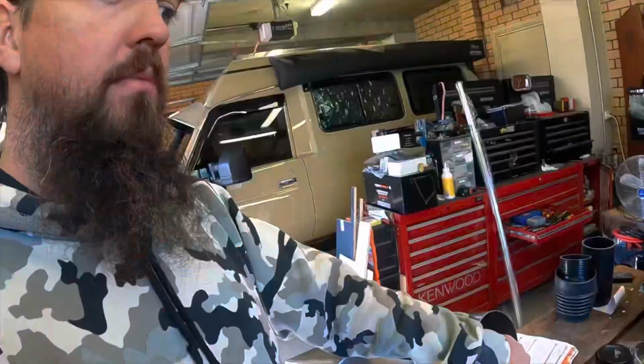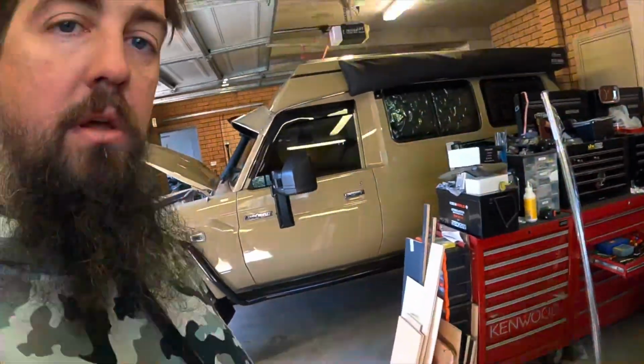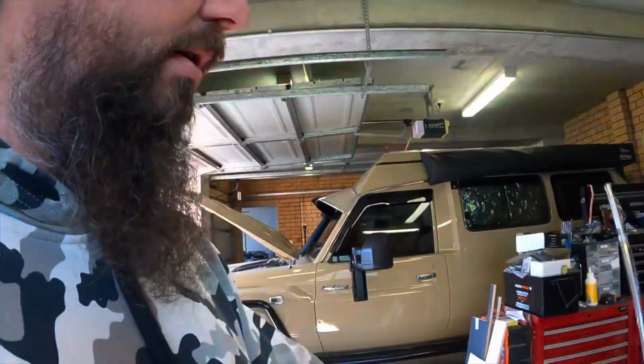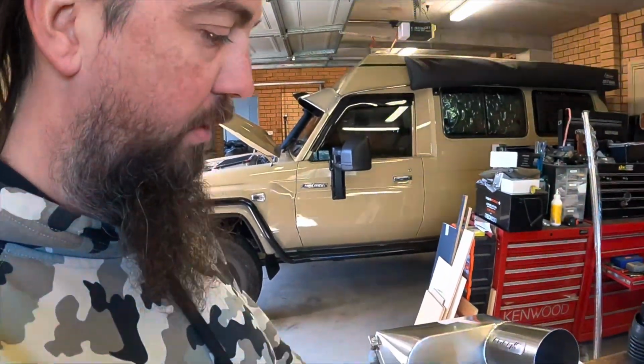The other thing was, there was a little bit of excess material inside that filter housing from the fabrication process when I received it, and there was nothing in the instructions about making sure components are clean, because they've already got the filter installed and stuff like that too. So if I just fitted that straight up, I could have got metallic crap basically straight into the engine, and also it probably would have popped off at some point and then dusted the engine, so not ideal.